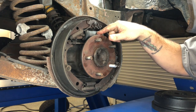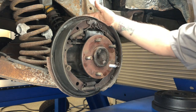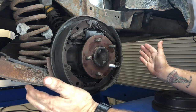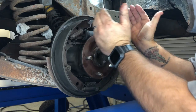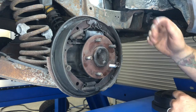This piece in the middle here is the hydraulic unit — this is called the wheel cylinder. When you step on the pedal, brake fluid comes in through the line in the back, pushes out right here, up against the shoes, and the shoes push against the drum to stop your vehicle. The springs work as a return system — once the shoes go out, they need to come back in. The springs push out, then come back in to reset so your wheel can spin again.